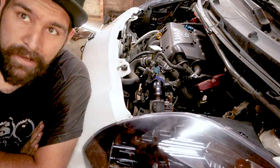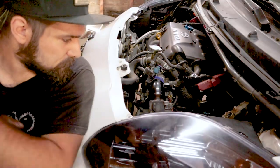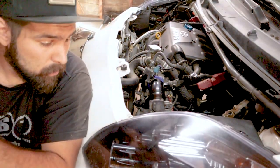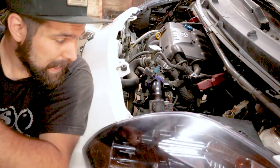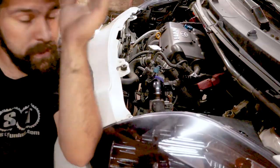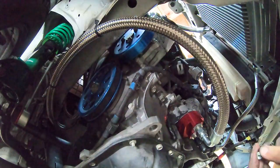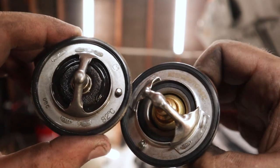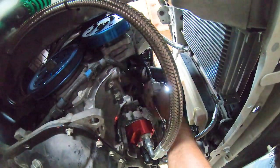I got the intake on. It's really just there so that we can test it today. I did order the new coupler, so that'll go on before this car actually goes out, but at least now I can turn the car on and see what this new throttle body and exhaust sound like. While I had the coolant drained, I decided to put in a new thermostat, which is going to open at a lower temperature and cool the car earlier on track.